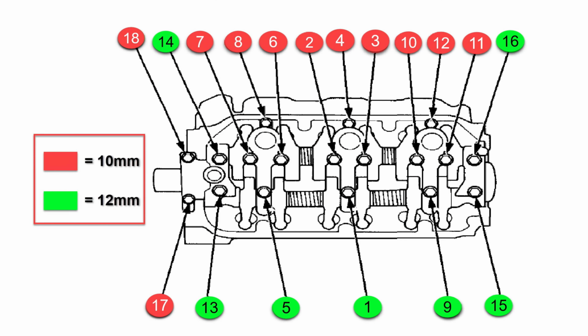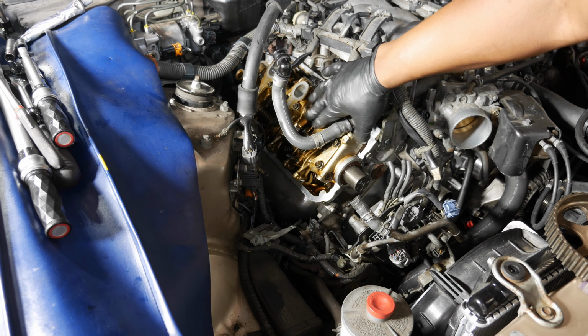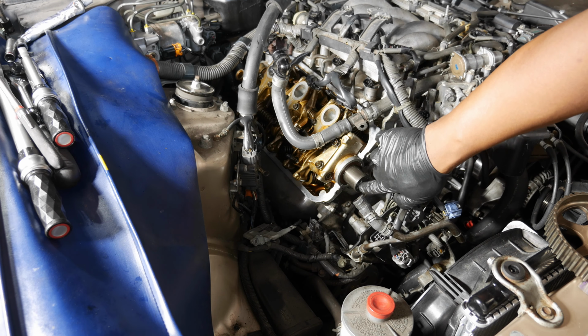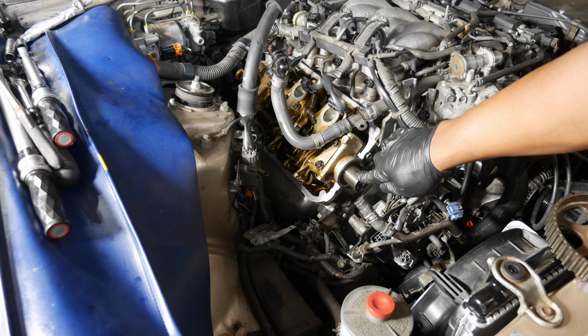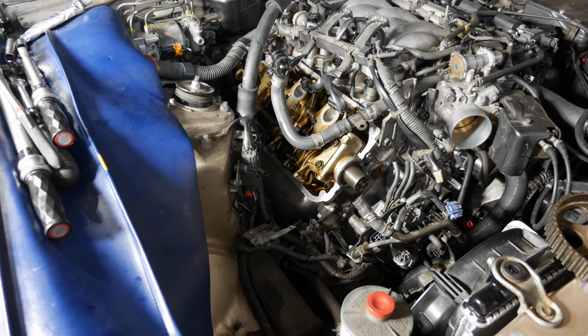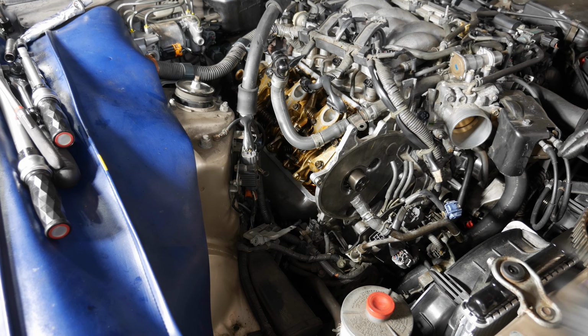Here's the bolt tightening sequence from the rear cam plug replacement video. The bolts should be tightened in 2-turn increments. Alright, so our camshaft has moved. So when I tighten this down, the camshaft jumped. That happens sometimes. So what we're going to do is put the cover back on over here and try to line up our marks with this gear. So put the cover back on.